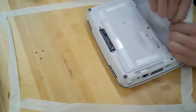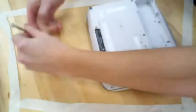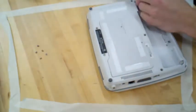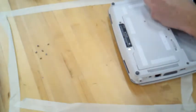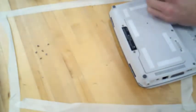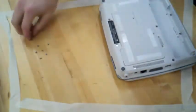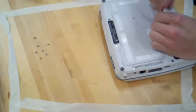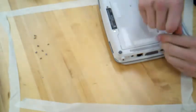I took apart the classmate earlier this build season — it took a little while. In this video I'm rushing through, trying to take it apart again real quick and videotape the process. I took the two screws out of the back cover, which covers the motherboard from the back. There are two screws for that. Then I took out three screws in those recessed holes in between the cover and where the battery is, and then there are three or four screws underneath the battery.